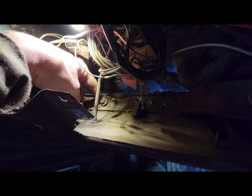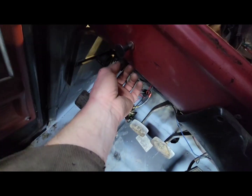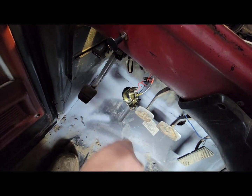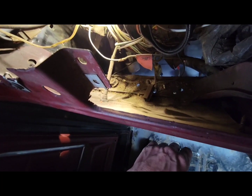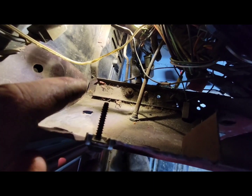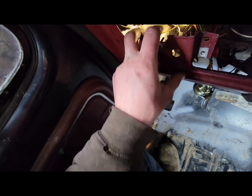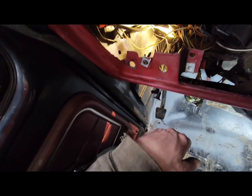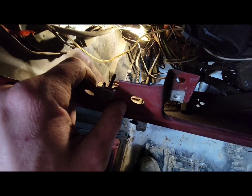So you have a 1/2-inch bolt there, and on the bottom is for your emergency brake pedal. So we'll take that loose now. Let's see. I disconnected this bolt right here. Now you have this one right here in the corner of the dash, and I'll free up the dash to pull out on this side. This bolt right here is a 1/2-inch. I'll take it out now.